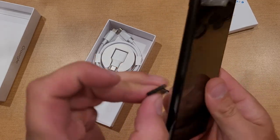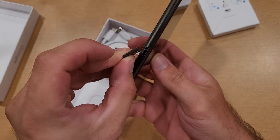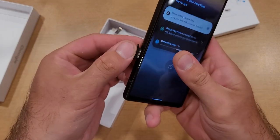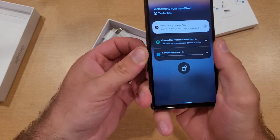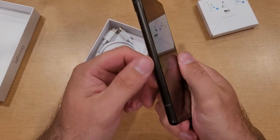When we are replacing this, make sure to line up the SIM tray with the proper placement so you guys have that hole lining up in the same place. Make sure the SIM card is in there properly and nice and flat. If it's sticking out or it doesn't fit properly, it's going to be hard to get it in there, and once it's jammed in there you will find it difficult to get it out. So make sure it's in flat and just install it just like that.